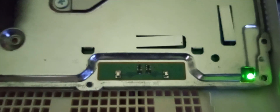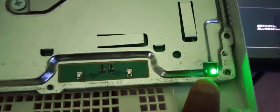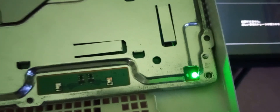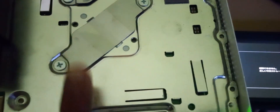As you can see it is a Japan import because of all the kanji here. Now I can put this all back together. If your PlayStation 3 turns on but has a yellow light then starts blinking red, that tells you there's a hardware failure. But before doing any repairs, you should always do a syscon on your PlayStation 3 to pinpoint the exact location of the issue.